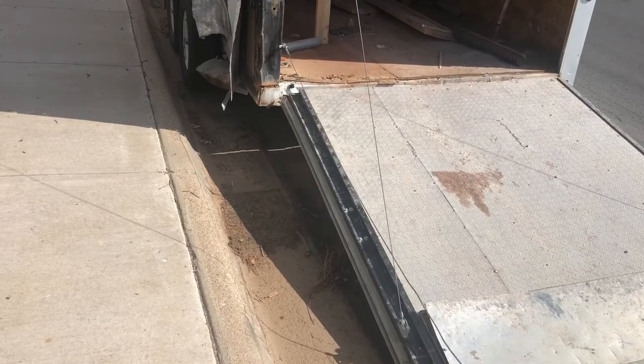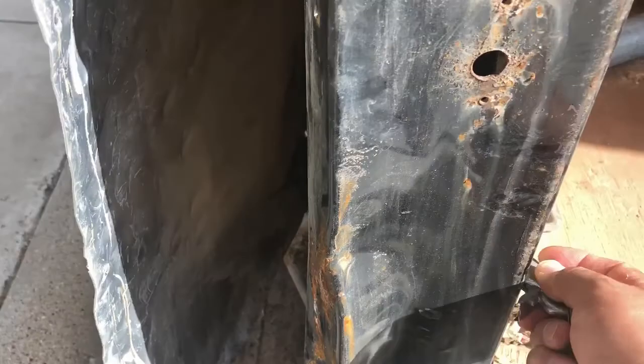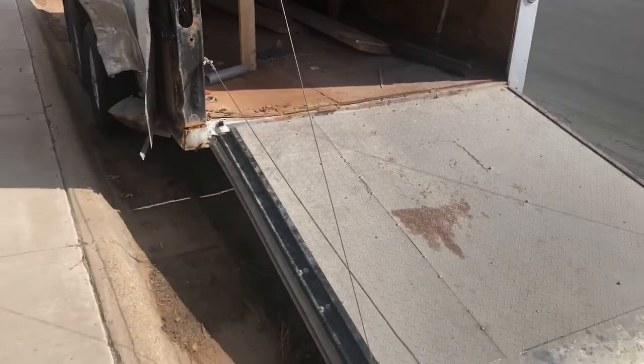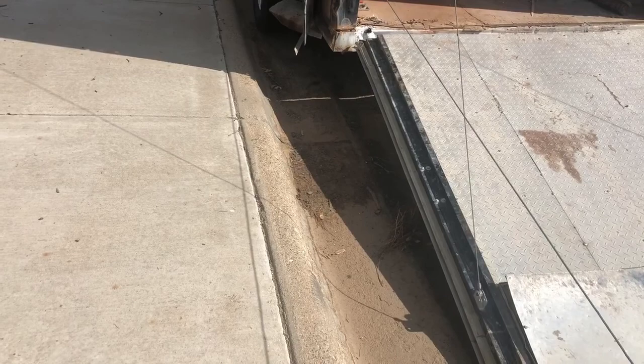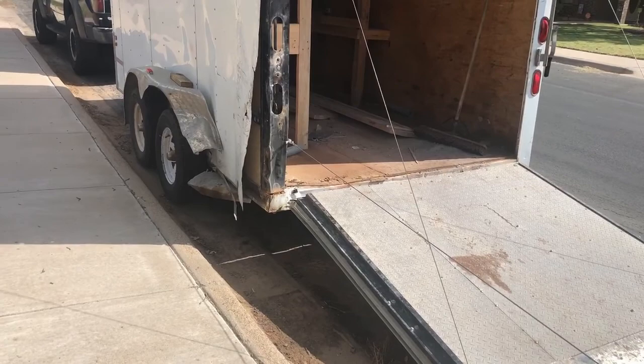As you can see, it pulled some of that. So now we can move it a little bit at a time. Every time you pull, it's going to go back some — so you have to pull it past where you want it to be and then let it roll back. We'll just keep doing this until we get this squared away. Looks like the kink is right there, so I'm going to try pulling right there. I'll come back to it — I'll put some tension on it and get my hammer on it.